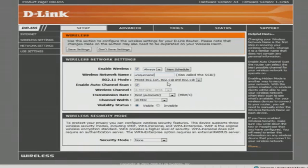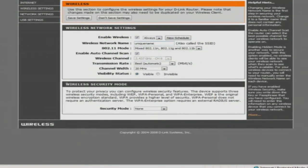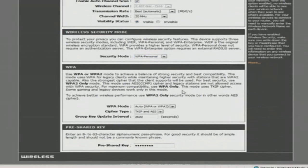The mode you can leave for now, and everything else here you can leave the same for now. Here's the security mode. The D-Link doesn't set any by default, so the data is not encrypted — you'll have to choose one here. The best one to choose is WPA Personal, because WPA Enterprise requires another set of authentication that most smaller home networks don't have. So choose WPA Personal.